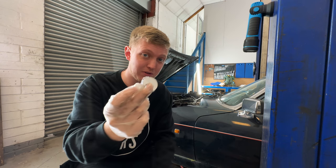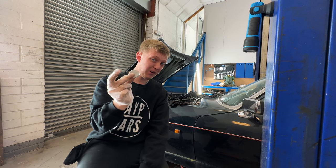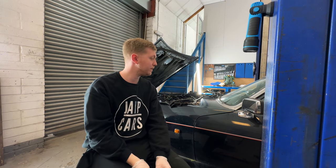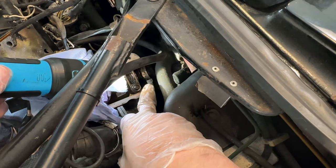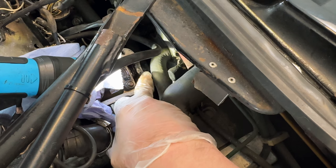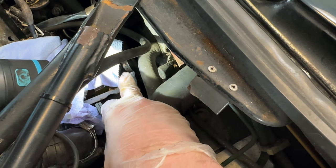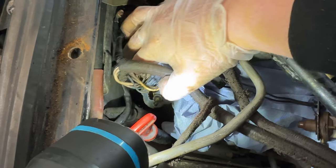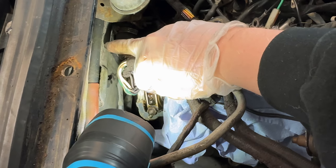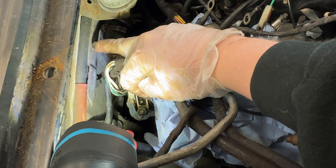So I've received the banjo bolts and the half moons, and now I can start giving it a go. This should stop the engine smoking, and if it doesn't then I'm going to have to take it all off and do it all again. So that's what we're going to be putting the half moons into - these little pieces in the back of the cams. You can just see the banjo bolt in behind. This side has got plenty of room but the other side, not so much. I can just about get my hand in to the half moon in there. How I'm going to get to the banjo bolt I do not know yet.